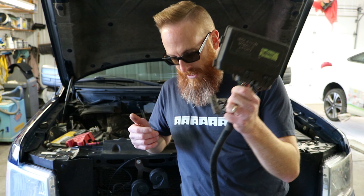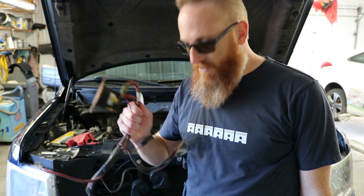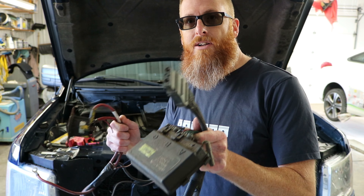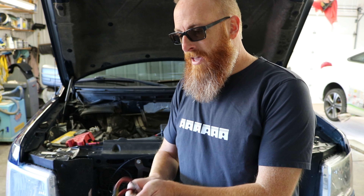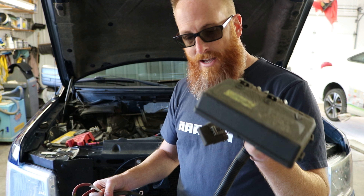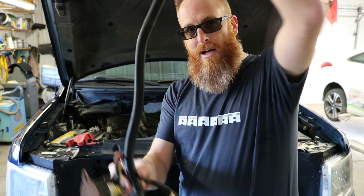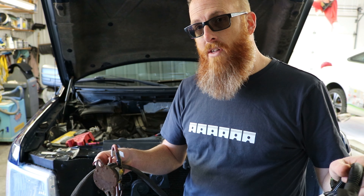We'll have to find a place to mount the isolation module as well as our solenoid for main power. With this solenoid, you're going to have the great big harness with the two pins on it that goes out to the plow to give everything main power. Everything else is controlled through the isolation box — your lights and all that. You've got a whole bunch of wires that come off of here that plug into your headlights and into your control module. So let's find a place to mount this first.